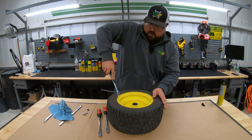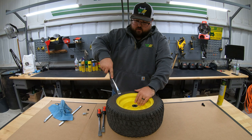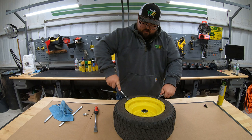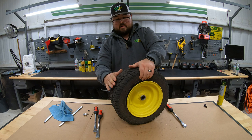Slow and steady. This one should come just a little easier because we've already gotten one side broken down off that bead, but a lot of times on these older tires, especially ones that haven't been changed in a while, breaking this away from the very top edge of the rim is going to be the way to go. Also, if you're doing this in colder weather, these tires won't be as pliable, so sometimes it's just a slow and steady job. And then just like that, gotten that bead broken from the other side. We can see that we are broken off the rim here and off the rim here.